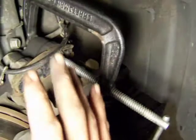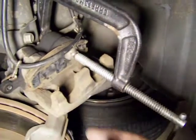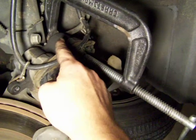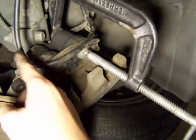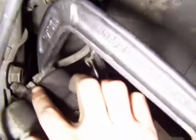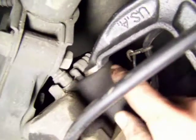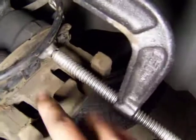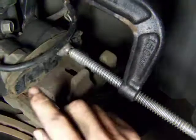It doesn't go fairly easy, but neither hard, so don't expect it to slide like a knife through butter. But if you keep twisting it, it will slide all the way back. Don't twist this until it reaches — this is being pushed all the way in. Make a few turns, switch to this side, push it in. Put it on this side but you have room — don't touch the brake fluid line, because you have room right here in the very back, on the very top of it. Attach it safely, you don't have to hammer it, just put the end in, the other end on the caliper, start turning the handle and this will slide in and push the pistons. Alternate back and forth.